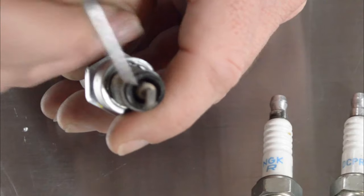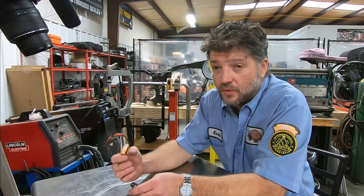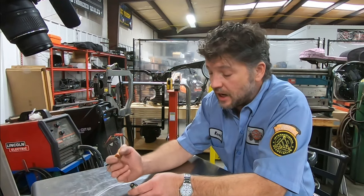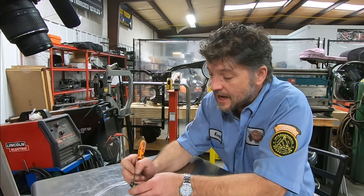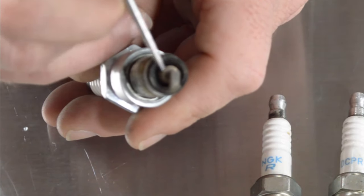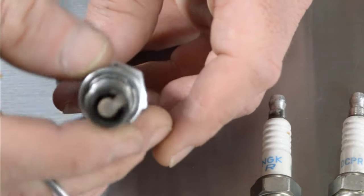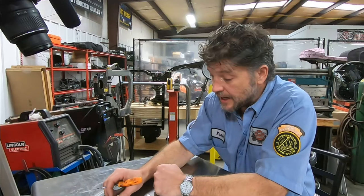When I look at the porcelain, I don't see that it's shiny. What can happen after a period of time is if you're running the wrong spark plug, or if combustion temperatures are extremely high, the porcelain will actually melt and get very shiny — I don't see that anywhere here. Remembering that this is from a carbureted engine, it's not unusual to see a good light tan color. This spark plug came out of an engine that was running and tuned fantastically.